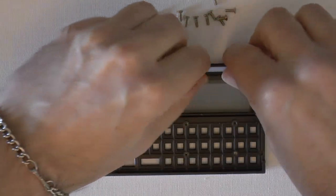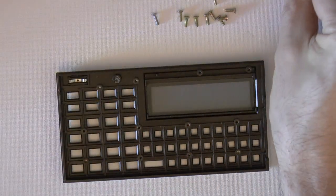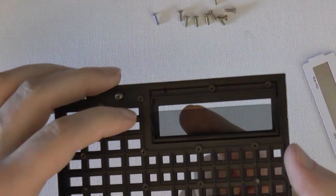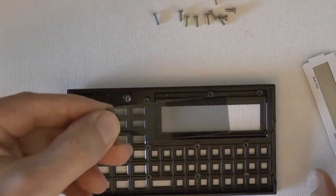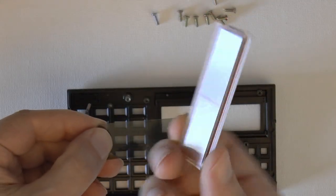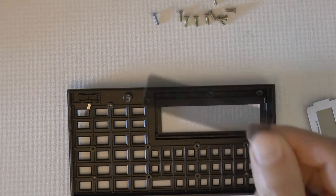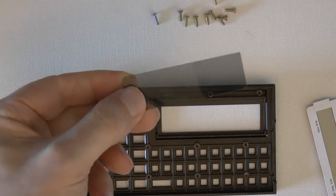Let's also remove this other elastomeric strip, which is really just a spacer — set that aside. Over here there is also the polarizer. The old LCDs only had a polarizer on the back and not on the front, which is why they had the polarizer as a separate piece. The new LCDs have the polarizer built in, so you will not need the old polarizer.